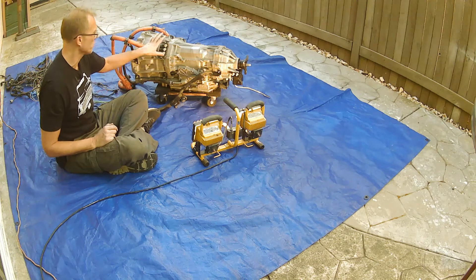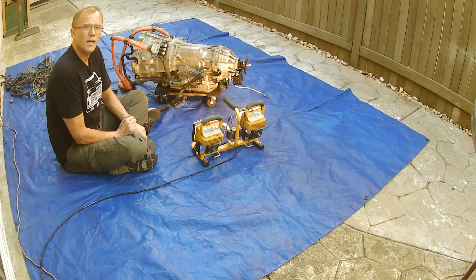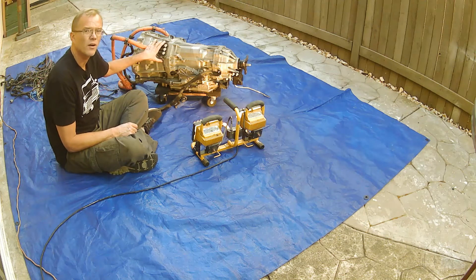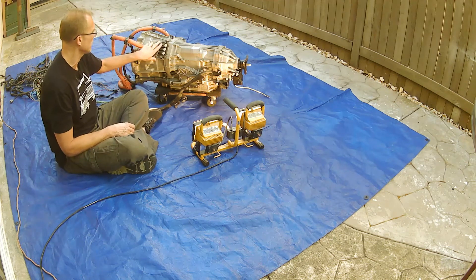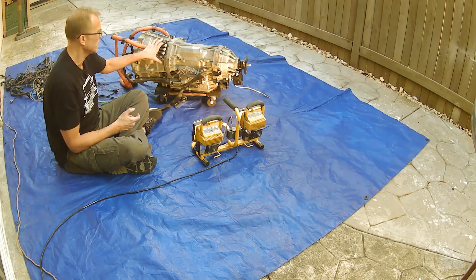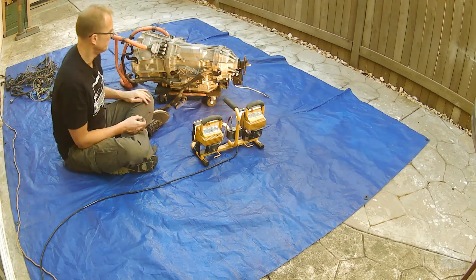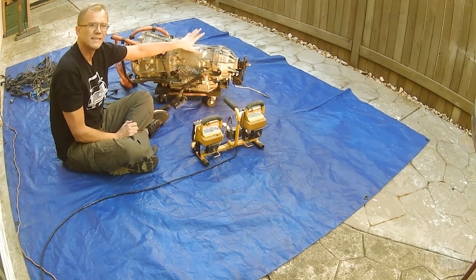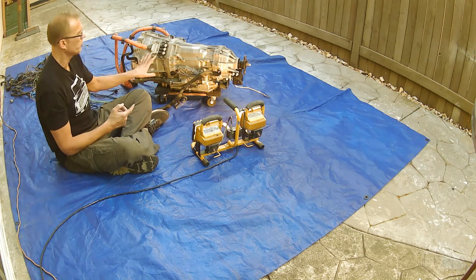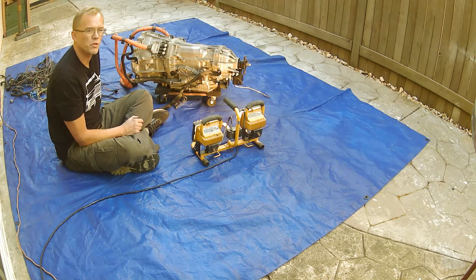These two plugs are both identical gray plugs for the MG1 and MG2 resolvers. MG stands for motor generator. MG1 is the first motor generator — its job is to work as a starter, like in a conventional gasoline-powered vehicle, using electricity to spin the engine to help it start. In hybrid OEM form, it never drives the output shaft. MG2 sits in the back; it's a bigger motor and that's the one that spins the output shaft. You can get both to spin the output shaft by locking out the input shaft on MG1.